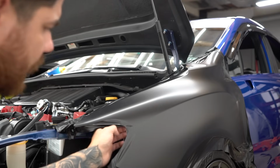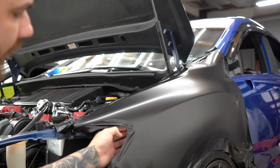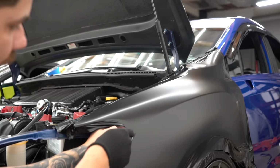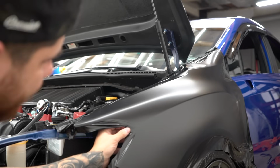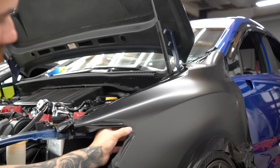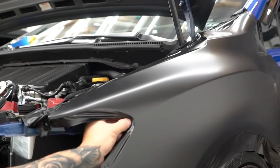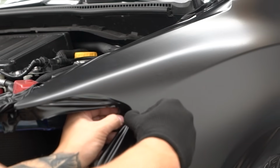Sometimes this can be a concern. You know, the material's almost like a drum. See that? There's a lot of tension on the film there, but it's not a terrible bend. So what you're going to want to do is give a little bit of relief there. Probably give a little bit more here too, just so I can send this material back that way. I'm going to give it some heat, and then you'll see I'm going to put my thumb up top, and I'm going to shift it back into where it needs to go. So it only needs to go to right here.